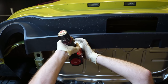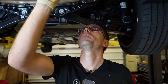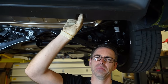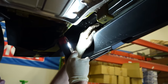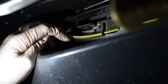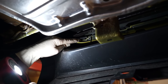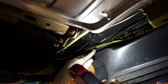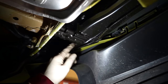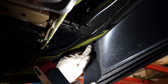We're going to start with these two little baby torx screws inside these clips, and then we should be able to just pop it down like that. So we're looking at the rear valance — this is the bumper cover right here, and that's the tab where you release the rear valance. You kind of push down and it will allow it to pull forward. You have to pull the valance while you're doing those. You can see there's also the rebar impact bar — this is what protects you in a car accident. We should be good to take this out with the bumper on the car.